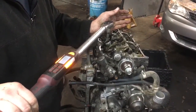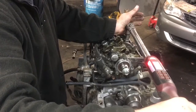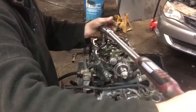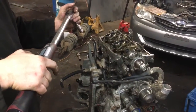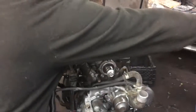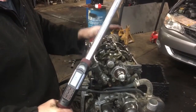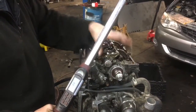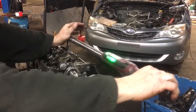Once you get A and B both to 25, go back over them a couple times just to make sure — you'll notice you get a little bit more each time. Then lower it down to 11 foot-pounds and do the remaining letters. After you've got them torqued down to 25 on the center bolts and 11 foot-pounds on the outer bolts, set your torque wrench to 80 degrees and follow the torque sequence.